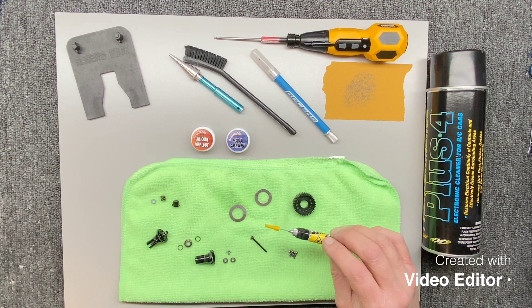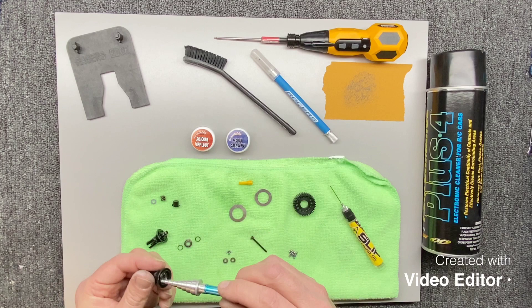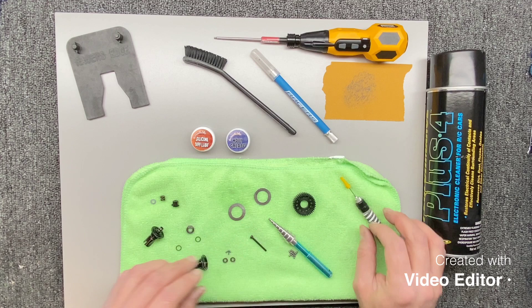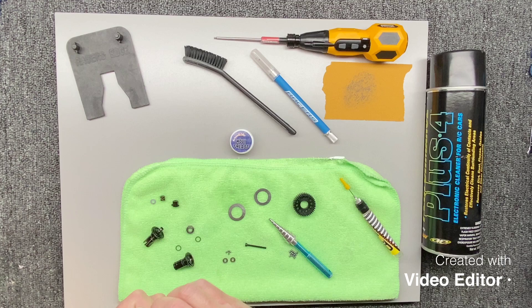Okay, so we're ready to start assembling. I'm going to use some oil here — just a little tiny bit on the bearings. I don't want to do too much because then your oil will get into the grease and the diff itself, thin out, and you'll be back in here doing this again. Use this little bearing tool, feel the bearings, make sure they're all good to go. That feels good — let's put a couple drops like that and then we can start to assemble.